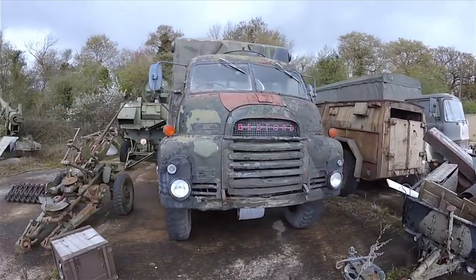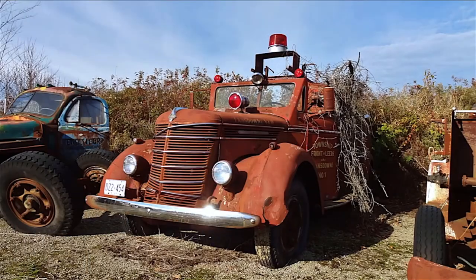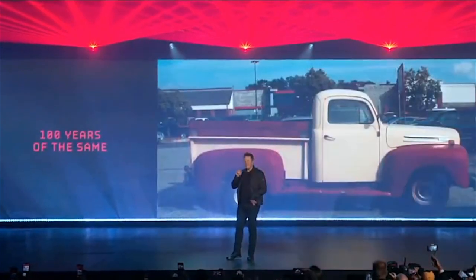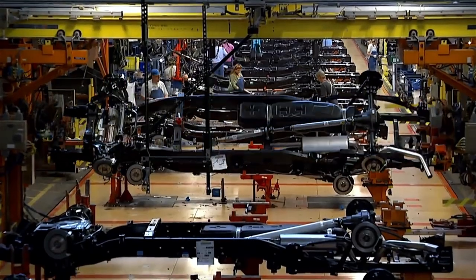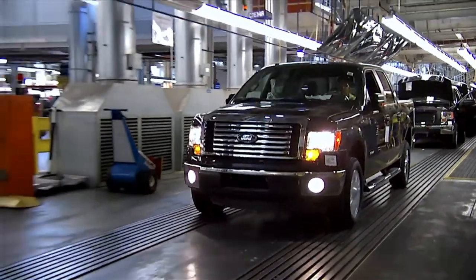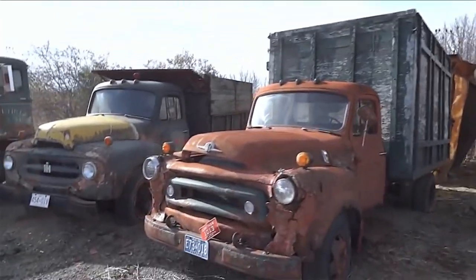In order to understand where body-on-frame construction started, let's look at the history of trucks. Initially, trucks were large vehicles carrying heavy payloads for military or industrial applications and were able to tow heavy trailers. But one day, somebody thought it would be nice to create a smaller, more personalized version of those large trucks. Since large trucks had a frame to carry their hull and cabin, a similar structural design was adopted in the pickup truck. The initial reason a heavier-duty structural frame was needed is that it gives the vehicle structural strength to withstand larger pull forces and torsional stresses. Many older cars had body-on-frame construction until unibody chassis were adopted for cost reasons.